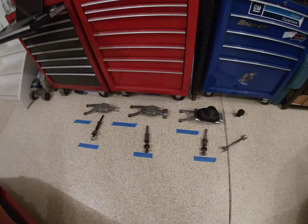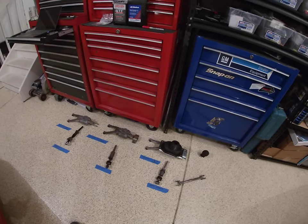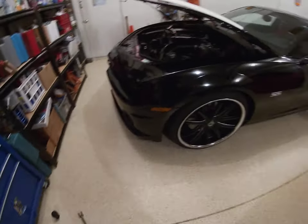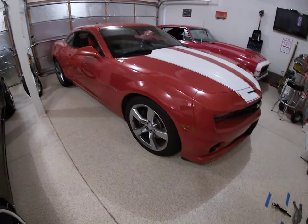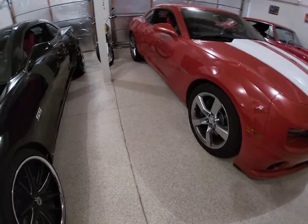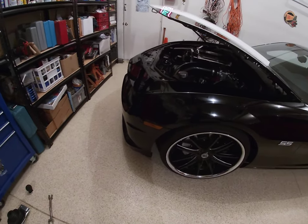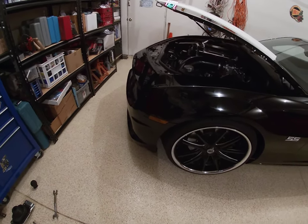As you go to install the MGW, you do have to drop the cross member, and you might be a little intimidated by that — it's not a big deal. There is some room for the engine to drop, and you don't really need a lift for it. I replaced both shifters just here in the garage at the house. It's convenient to have a lift, but safety stands and a floor jack will do. One tip they're not necessarily going to share with you: I recommend having the hood open when you're doing that shifter swap.